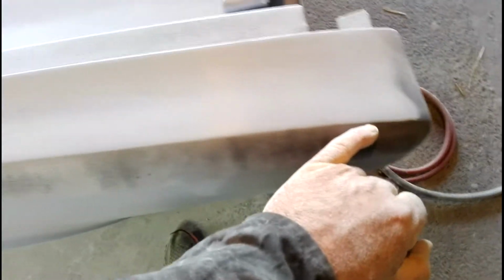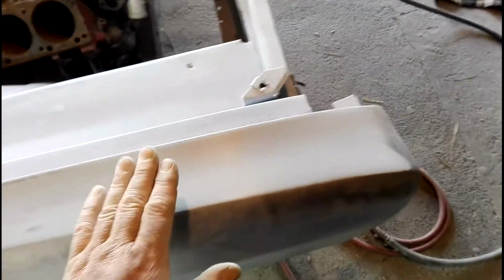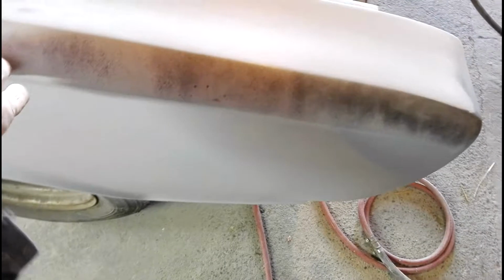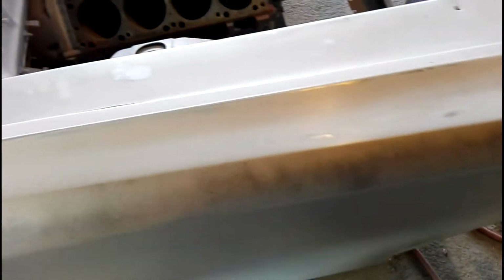So you just take your time slowly, and I'm trying to get a nice, clean, crisp edge on that line. Basically, don't go over that, just sand up and over it, and don't roll over, just keep it nice and flat as you come across it. When you've got that right and you're happy, or as far as you're going to go for this step, I'll start doing that along here, but I won't go past this bottom edge either, because I'm trying to get these edges really nice and clean and sharp, and as straight as I can get them.